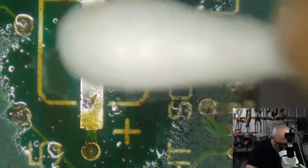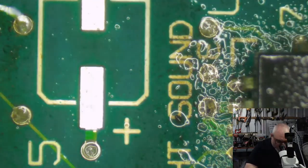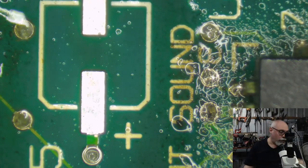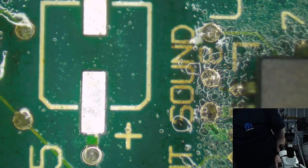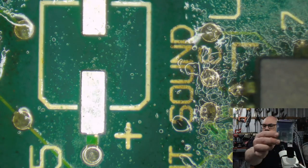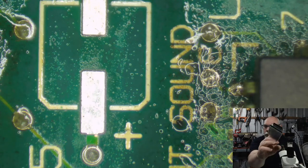What I would recommend, I generally recommend with anyone who's doing a bit of collecting of vintage Macs, to get an external SCSI case with something in it, whether it be an actual spinner hard drive or a SCSI 2SD. I have one of these. This is a SCSI 2SD version 5.5. Now, they need to be fiddled with a little bit to work properly on a Mac Plus, but you can get them to work on a Mac Plus.